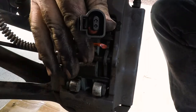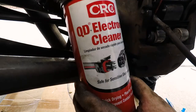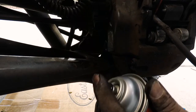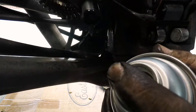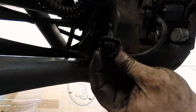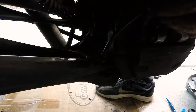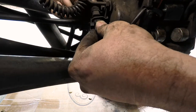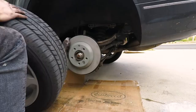Last little step is to plug the brake sensor warning plug back in. Before putting the plug back in, hit it with electrical parts cleaner — some dirt, water, or anything can get up in there, and cleaning it will help prevent the brake sensor warning light from turning on when it doesn't need to. Let it dry for a second, then plug it back in and listen for the click. Now let's put the wheel on.